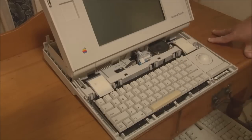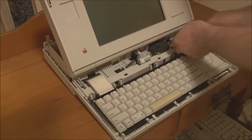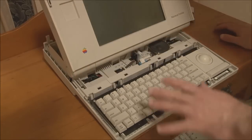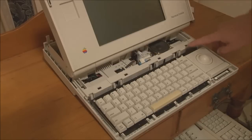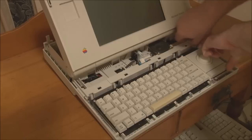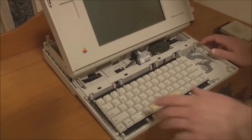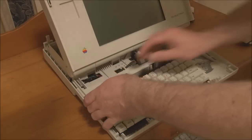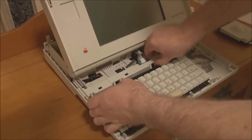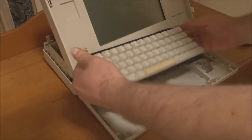The next thing is to take the keyboard and trackball out. To do that, unhook the data connector for the keyboard and the connector for the trackball. To remove the trackball, push back on these two plastic tabs while pulling up on the trackball mechanism — it will free itself and you can remove it straight out of the system. It's the same with the keyboard, but because of the number of tabs you have to work your way carefully across from the left, popping the tabs as you go without putting too much stress on the keyboard.